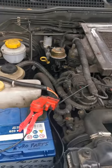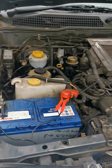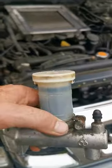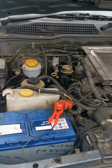Nissan Terrano, Terrano 2. Pedal going straight to the floor, not returning. It happened before when I changed and put a new cylinder on — this is many years old. I've had to put a new one on; basically when you're trying to bleed it, it wasn't even pushing fluid out of the bleed pin on the top there.